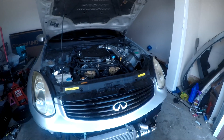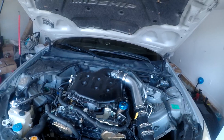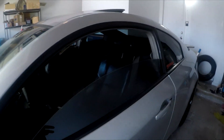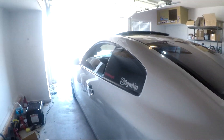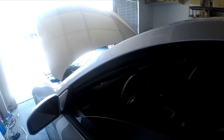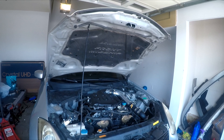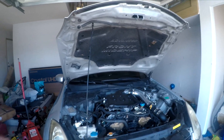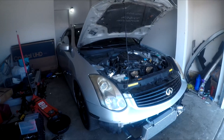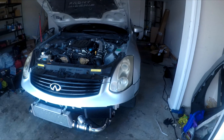So I think I've covered most of the essentials: hot and cold side intercooler piping, oil lines and possible coolant lines, a PCV system, gauges, and an upgraded fuel system. Also, if you have a manual car, you'll probably need to upgrade your clutch because your stock clutch will start slipping with a decent amount of boost. This is all very general — you'll want to do your own research on your specific car. I didn't build my engine and that's why I'm not going crazy on boost; I'm only running seven pounds. But seven pounds is more than enough — I'm spinning tires at four and having a lot of fun with it.